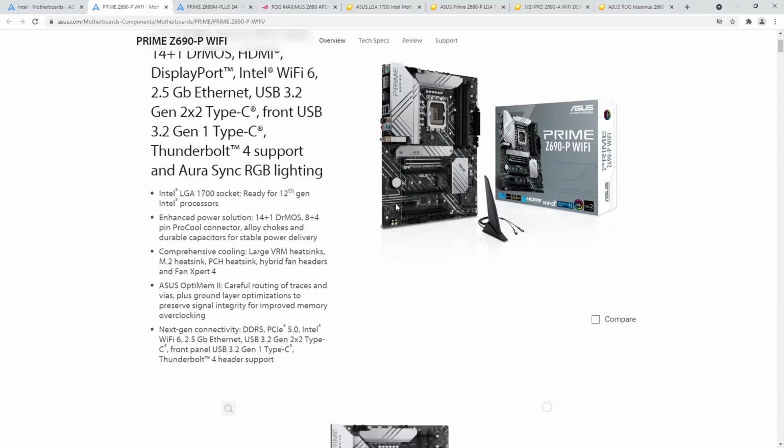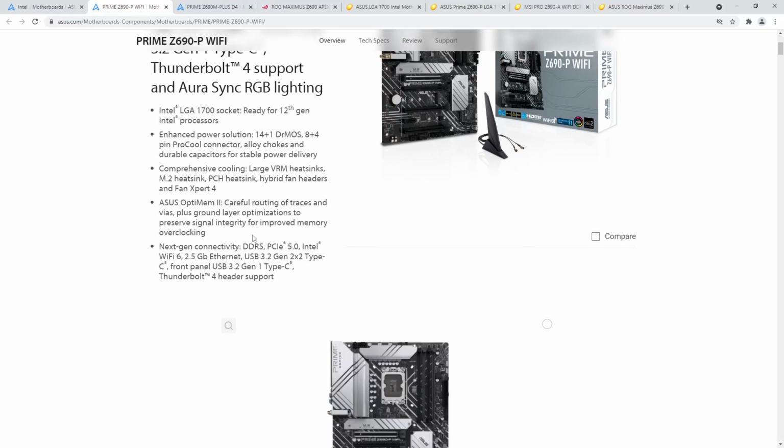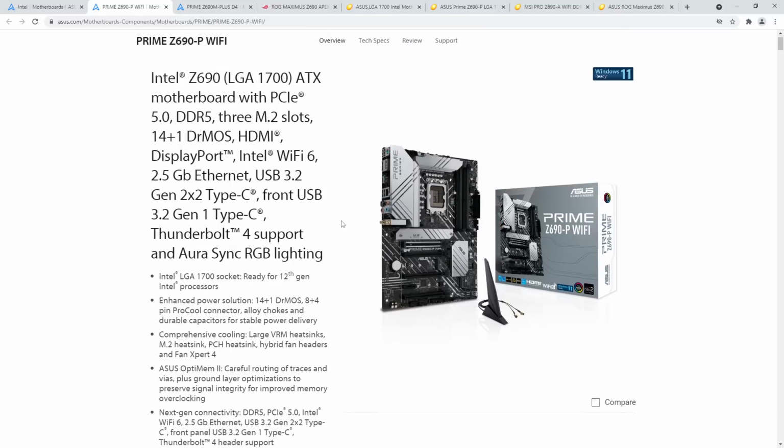You have a CPU menu with CPU settings, you have voltage. So MSI BIOS is best organized, least annoying, least confusing. I just wish they were better about including VTT DDR control on their DDR4 motherboards, which admittedly is a function that ASUS regularly doesn't have in their BIOSes either. I think it's only ASRock and Gigabyte that very consistently include VTT DDR controls in their BIOSes. So, yeah, I don't like any BIOSes that much. I'm just used to the Gigabyte one the most.